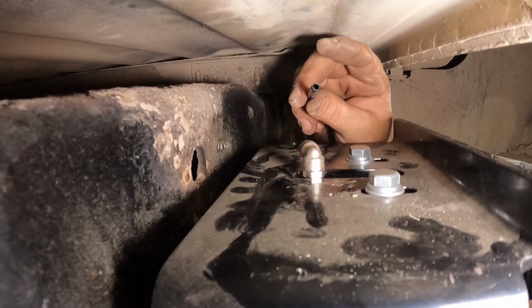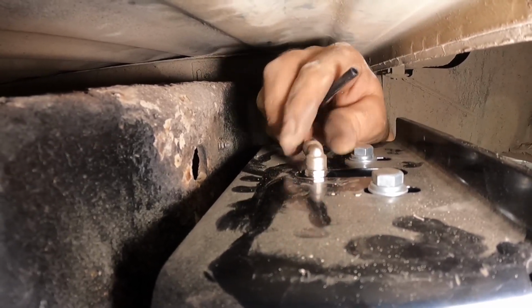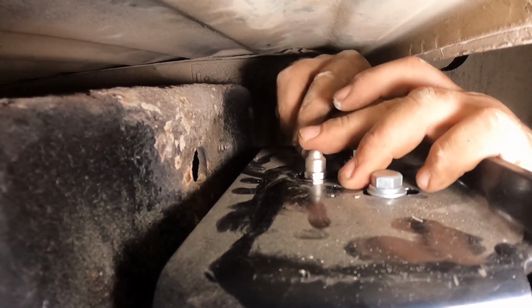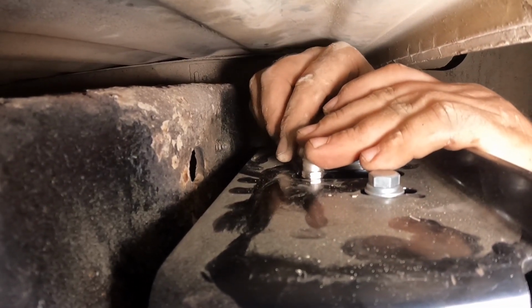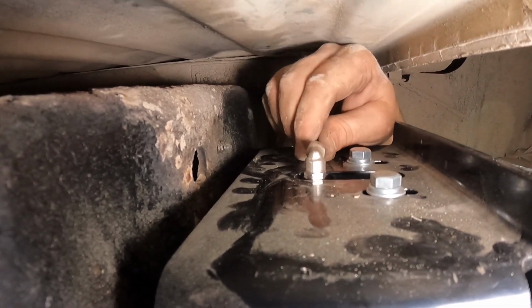So we've got the cut. You can see it's nice and round. It hasn't been smashed. Here's the upper valve. It's kind of like a shark bite. We're going to slide it in there, and it's going to lock in place. I'm going to put my finger on it to hold it steady, line it up, and I'm kind of doing this blind. And now I've pushed the airline in all the way. You guys can see it's snug.